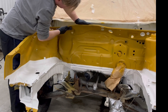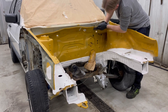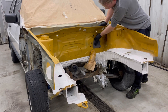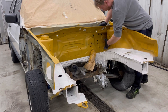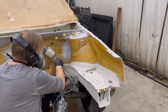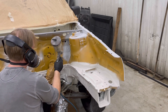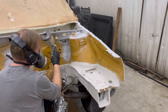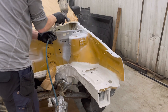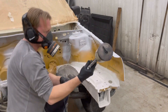It's really important to take the time to have it done nicely because I don't want the paint to come loose after a few years — that's why it's so important to have everything sanded first. Here you can see I have finally started to apply one coat of filler. This first layer is pretty thick, and as you'll see it will take a really long time because I am using the same paint gun for both the normal paint and this filler.